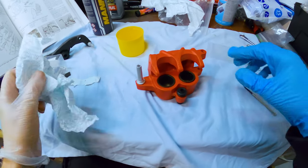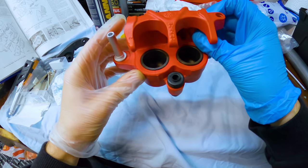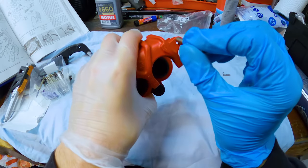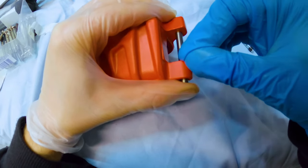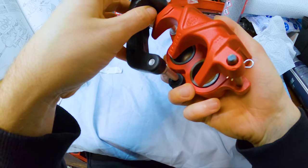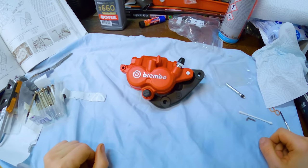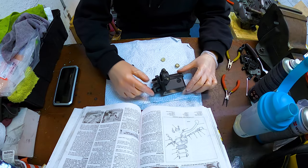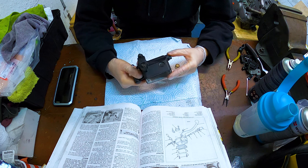Next one — exactly the same: thick seal first. When you look at it, it looks like it's not going to go into that hole because it looks a lot bigger, but obviously they're quite recessed in there. There we go. And the last one — both in nicely into that groove. I'll give it just a bit of a clean up with some brake cleaner and that should hopefully be it.